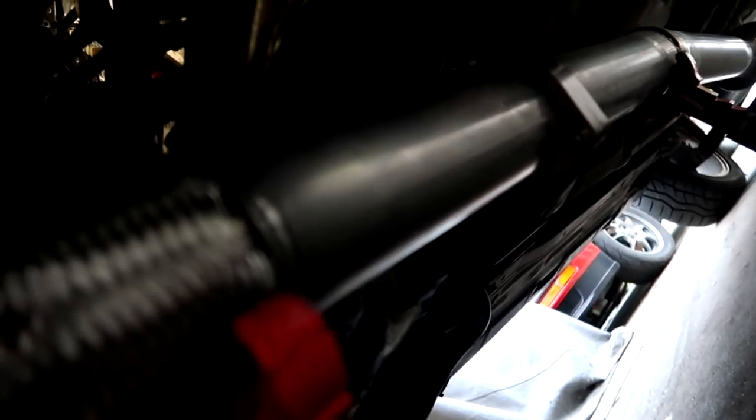So here I just decided I want to add that 2-inch right here to kick this 45 out towards the driver's side a little bit. And with the flex pipe in place, I'm sorry it's dark, but we have a good finger gap between the transfer case, no interference whatsoever, right? And then this is not a 45 bend, I just cut the 45 in half, and that pointed this part right here off the flex towards the back to the exhaust with the two flanges attached over there.